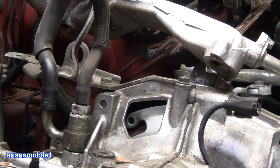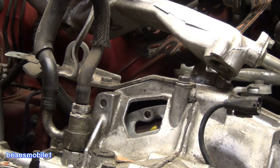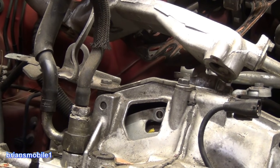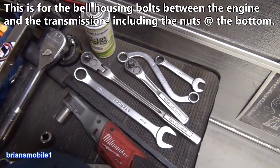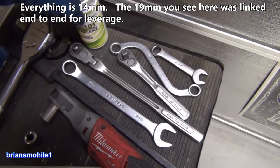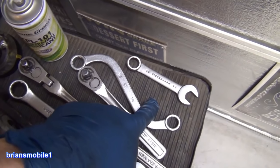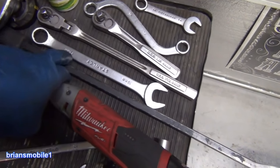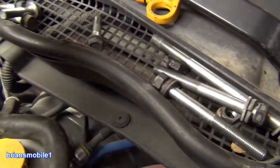What's behind that is not moving. Let me put a paint mark on it to make this easy to see — see that yellow mark? Watch: now you see it, now you don't. Here's my secret: this Subaru is from back east so it was a little rusty; I used some penetrant on it. I use an S-wrench, the 14mm side, Harbor Freight stub wrenches, ratchets, a pry bar, and a sledgehammer.